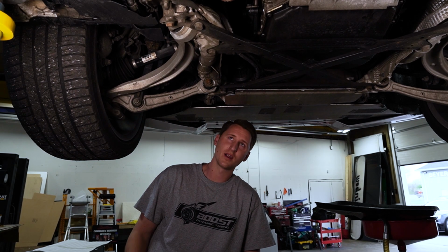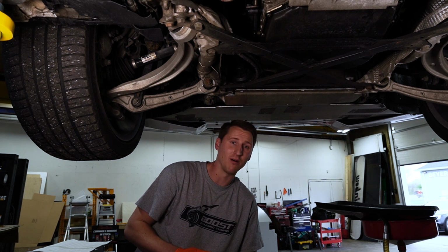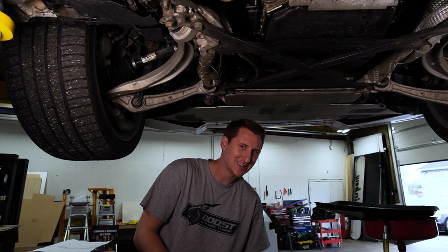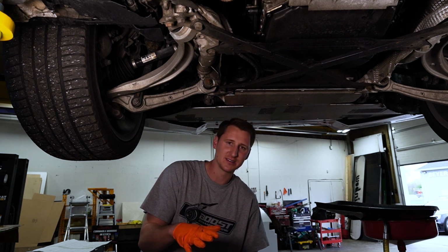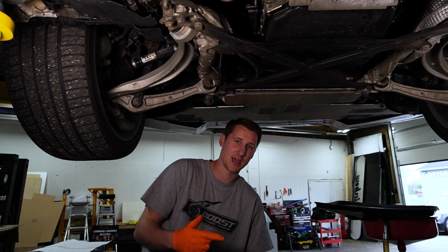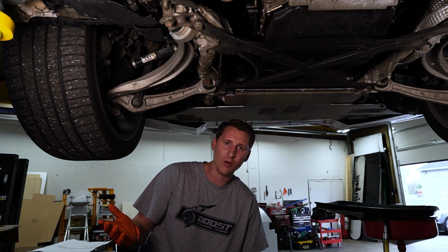Alright guys, so we just got a fluid sample. Just to let you know, that was not really pouring out. Kind of scary, I don't like that. It should pour out. That was dripping out. And also it's above temperature. It's supposed to be at 45 Celsius when I do this test, it's at 55. So it's not even pouring out above temperature. Kind of makes me say, hey, what's going on? Where did the fluid go?